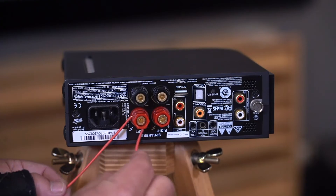You'll see three wires. The basic color coding of life is that hot colors are hot — that would be the red and the yellow — and black is ground. This is not connected to an RCA. This is a high-level connection, meaning it's coming off of the binding posts on the back of your power amplifier.